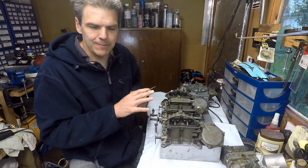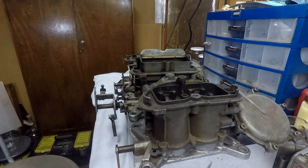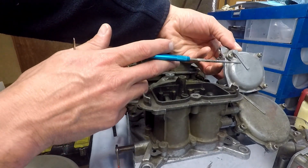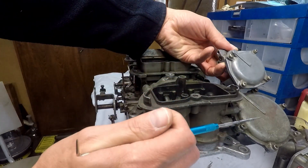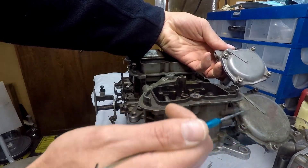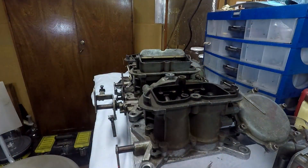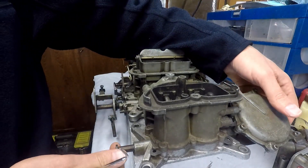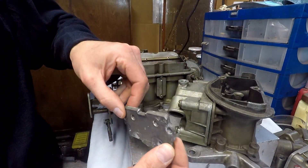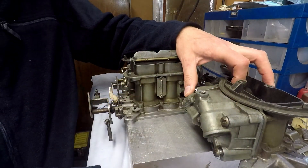This is what I call the outboard carb — the secondary carbs. As you can see, the secondary port: this is a normal standard 4141/4150 port, and this one is much larger. The diaphragm is about twice the size of a standard 4141/4150. In the case of the Chrysler one, the way it functions is that inside here it has a metering plate — let me show you very quickly.